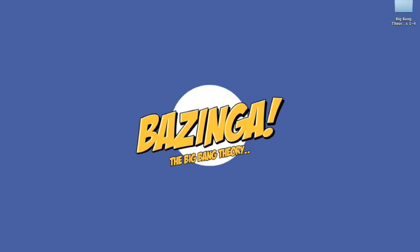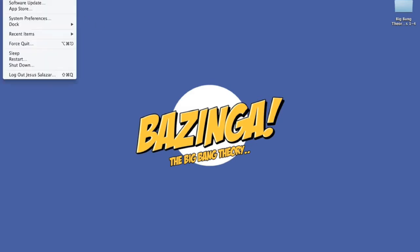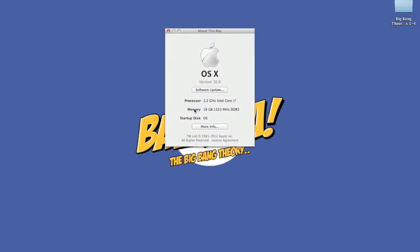Before the video ends, I just want to show you guys how you can see if the RAM actually worked. What you want to do is go to your Apple logo and press About This Mac, and you should see the memory just installed there. If that's not the amount you installed, recheck to see if you installed it right, or it may be bad RAM. You should troubleshoot that. Thank you guys for watching, please subscribe.